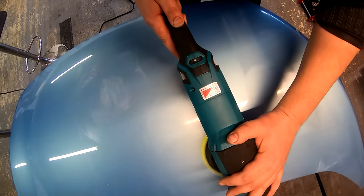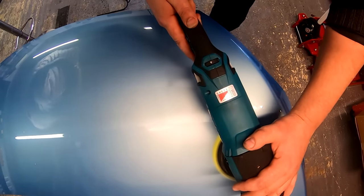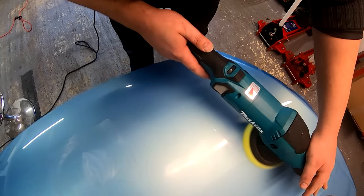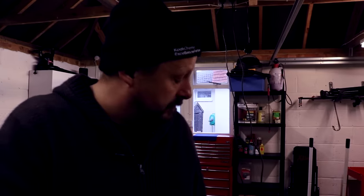I like the free-spinning mode. Someone said to me you don't really need to use the free-spinning mode, and I can understand that — because really you want the forced rotation mode on when you're cutting paint. If you're turning it off because the machine is fighting you, you need to solve that problem, because there's no point getting this tool if you don't use it in forced rotation mode. That said, you'll perhaps use the free-spinning mode when you want to just whiz over the paintwork and polish it up where you don't need that consistency and aggression — though you could still use finishing polishes in forced rotation mode. I'll do some testing on that.